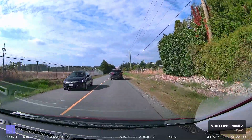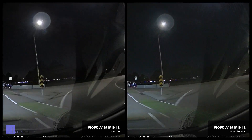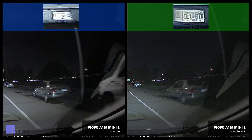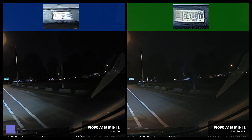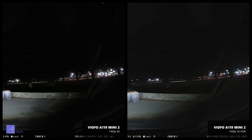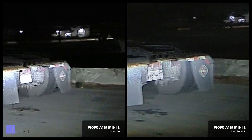Then finally, night time — to me this is the most interesting part of the video. In a side-by-side shot going slowly past cars at about 30 kilometers per hour, neither mode is actually readable at that speed. But at least for the HDR video there were places where I could make out that the plates had letters — not necessarily what the letters were — whereas in the 60 frames per second video my headlights just blow out the plates. Then when slowing down going around a corner, the HDR video on the truck's license plate is pretty much entirely readable.